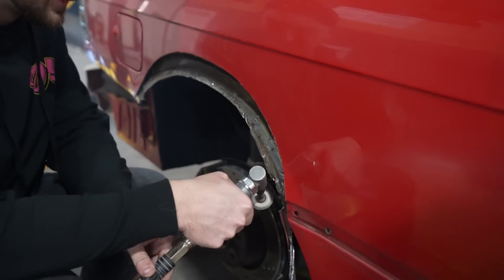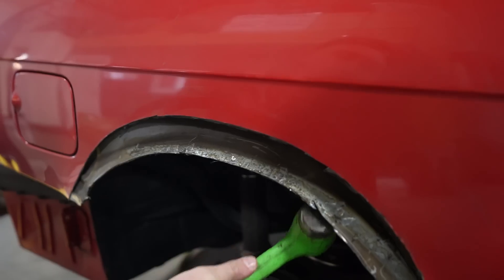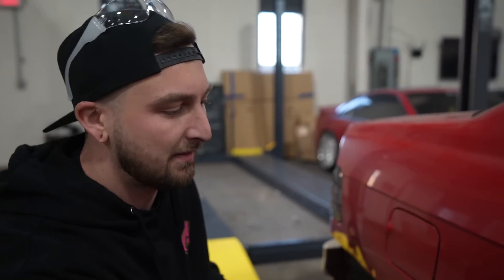Satisfying. Now we don't have a huge gap - only about an inch and a half. My S13 had like four inches. But this metal will stretch. You can see it moving closer. We've got to sit here and massage this thing for a minute, but it'll be worth it. A lot of guys have probably seen that slit-and-bend-up technique where you cut slits into the inner wheel arch and peel it up and seal it to the chassis. It works if you're sealing your car up, but this takes a little more work and I think it looks a lot nicer when you're done.